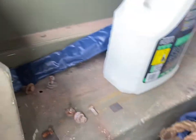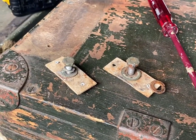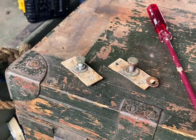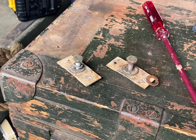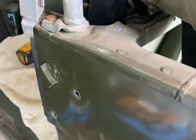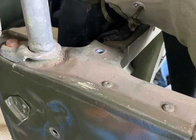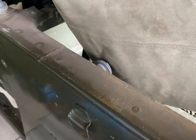This could be fun. The side body is held in with these captive nuts that are pop-riveted on, and the pop rivets are 40-odd years old and didn't really want to work. These three fasteners come out — that's the whole top panel loose.